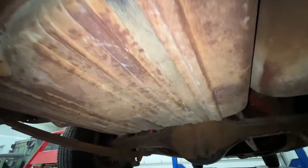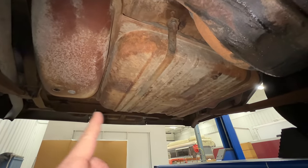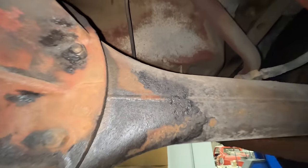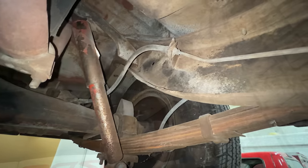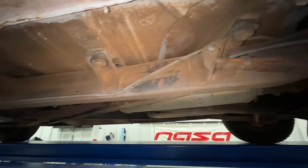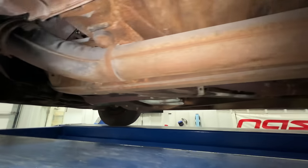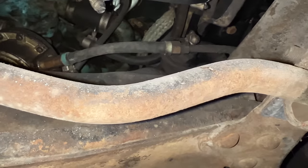Let's take a look under the car now. We can see the bottom of the spare tire well, and here is the fuel tank. Fuel comes out of the tank on that line, and then curves around to the opposite side of the frame. Here it is coming down the top of the frame, and then ending up on the outside of the frame. We can follow that all the way up to the front of the car, and then it crosses over the top of the frame and into the fuel pump.